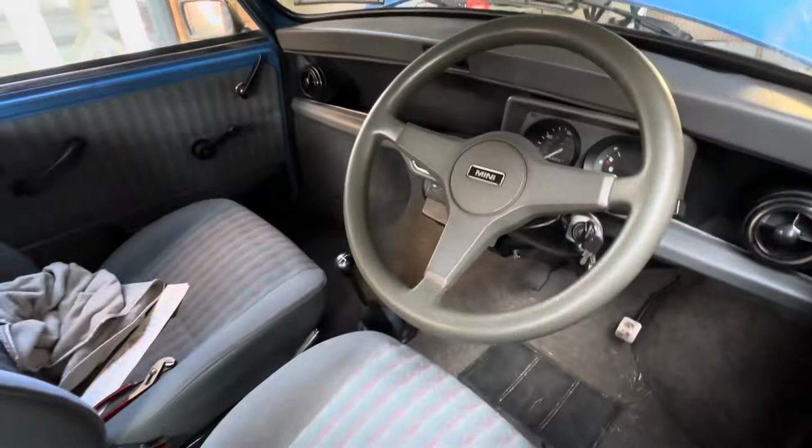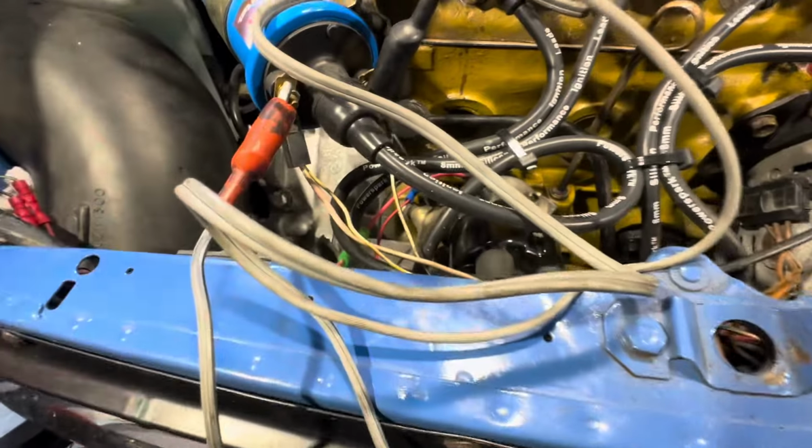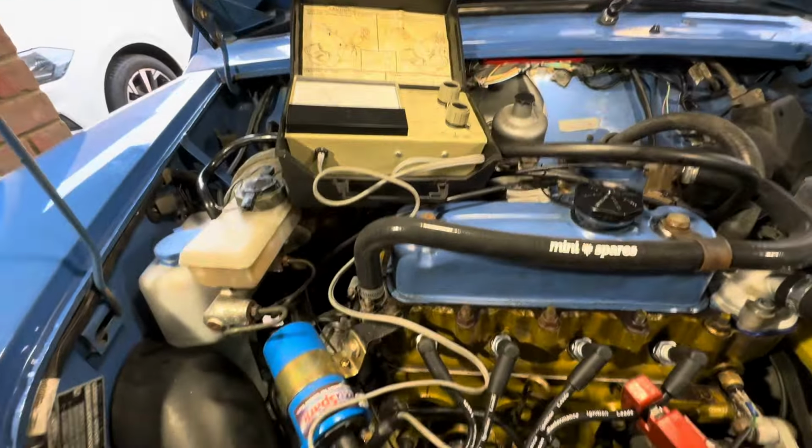Okay, so first things first. Engine's running at the moment, and I've got the dwell meter on. And as we've already seen before, this is a variable dwell dizzy, okay? We've got the correct 1.5 ohm coil, but as you can see, we've got a ballast resistor fitted with a variable dwell. So again, we're losing out on coil power, and this engine won't start straight away because it's only got half the coil power when it's trying to crank. So what I'm going to do is put the bypass wire on and hope again that the module doesn't overheat in this case. If that was a power spark one, I'd know it would work straight away, but in this case, I'm not sure. So the owner's given me permission to do that. So let's dig in, get that changed, and then we'll look at the spark plugs.